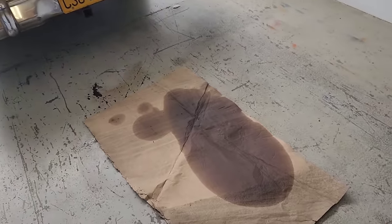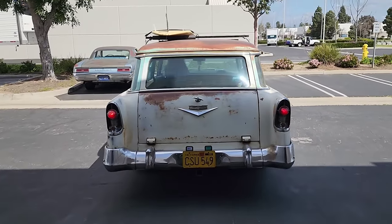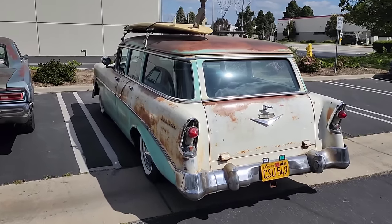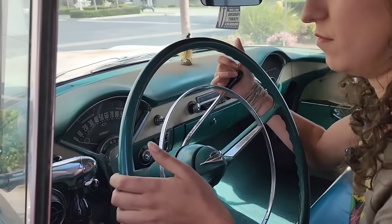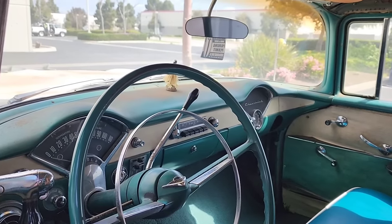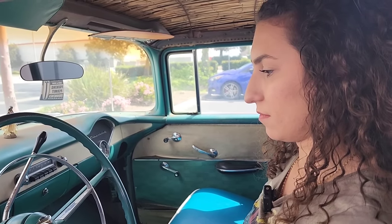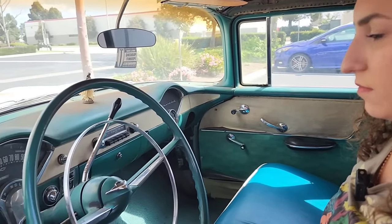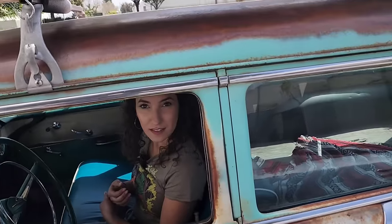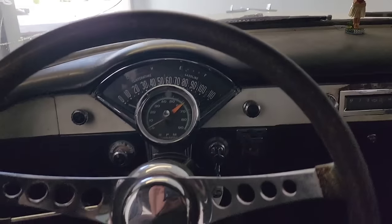Oh my gosh, Duke. Yeah, put him in park. And then can you just give him some throttle for a little bit to get that oil sloshing around in there to oil up the cam and hold it up a little higher. Almost like you're breaking in a motor. And then once he gets warm, we'll just let him idle here. Get it all charged up. You want to pull out Hank? All right, Hank.